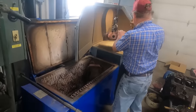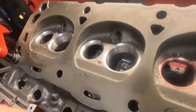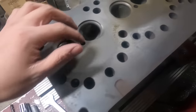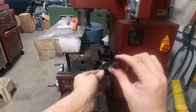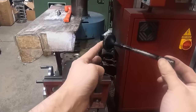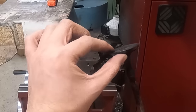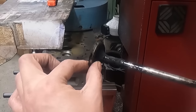Dad's doing some cleaning, getting some John Deere heads ready for me to do the valve jobs on. Got one of the John Deeres on the surfacer. The exhaust seats are just completely worn out — they got their money's worth out of this one. It's probably going to be hard to tell, and the GoPro doesn't focus up close, but you can feel the edge. They're just all curled up on the edge, completely cupped out and worn out, so they'll be getting new valves.